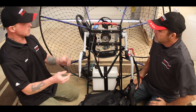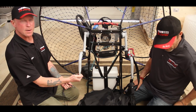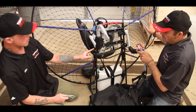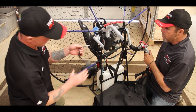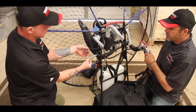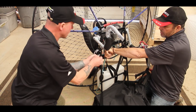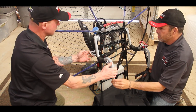The first step: as the assembly video for the Kestrel frame goes, you'll already be at this stage so everything's already on. The easiest thing to do is lift the swing arm up out of the way. This big round tube here, the J-bar mount, is what we go around. Just take your retention strap, go over the top and around. It'll look like this and then you can go ahead and go around one more time and bring it back through.